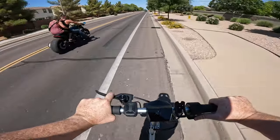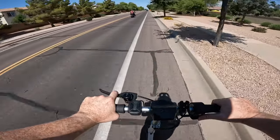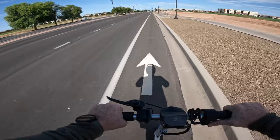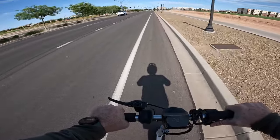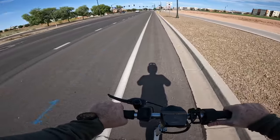One thing that got me particularly excited about this scooter is the fact that it comes with a 48 volt system. A lot of budget-friendly scooters, even commuter scooters, typically come standard with 36 volt systems. The benefit of having that extra voltage means more torque, more acceleration, and less voltage sag. On a lot of scooters once you get past 50 percent battery — basically the bottom half — you're going to see power drop off quite a bit and you won't be able to hit those top speeds. With 48 volt systems, relative to 36 volt systems, you'll have less of that voltage sag.